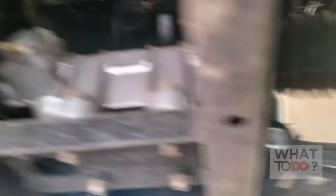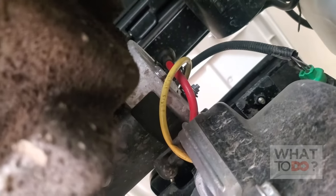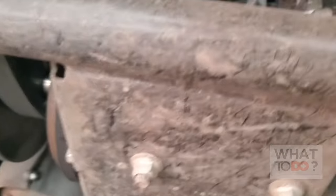We don't need to inspect anything to do with suspension — it's going to be more or less where your wires are, starting where the pedal is, because when you depress the pedal you're getting nothing. Everything here in the pedal seems to be connected. We'll go back and look at some of the wiring. Up there is the starter, and you can see the wires from the starter — you can access them from above. Check them all, make sure you don't see any breaks, make sure they're tight. They all seem to be pretty tight and good. Upon inspection, all the wires seem to be okay.